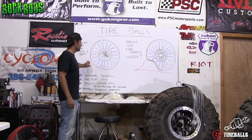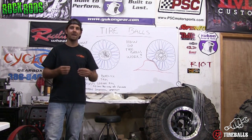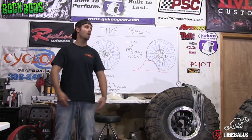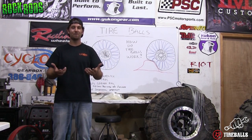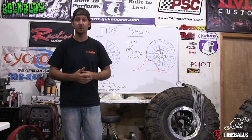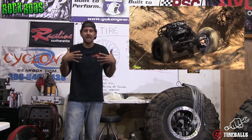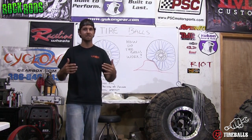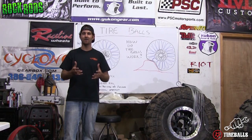These things are really good because you can run a really low tire pressure and get a big tire contact patch, but at the same time you don't get any of the negative drawbacks. We rock bouncers run a whole bunch of tire pressure because we're hitting ledges at 30 miles an hour. If you don't have enough psi in your tires when you hit that ledge, the tire collapses, hits the wheel, cuts the tire, and breaks the wheel. With a tire ball you can run what looks like a low pressure in your tire, but it doesn't collapse.